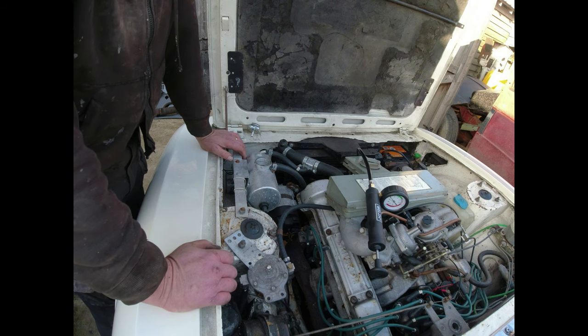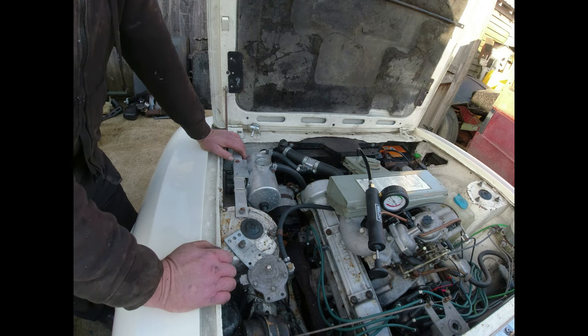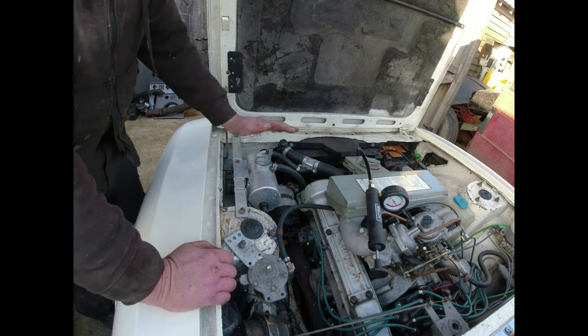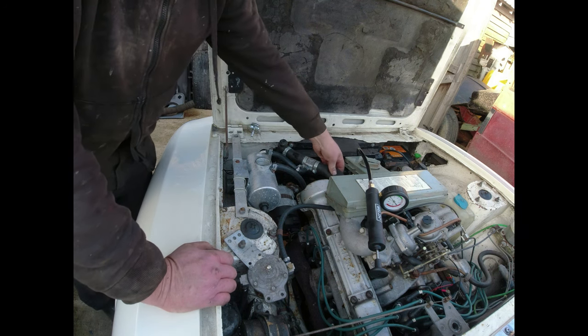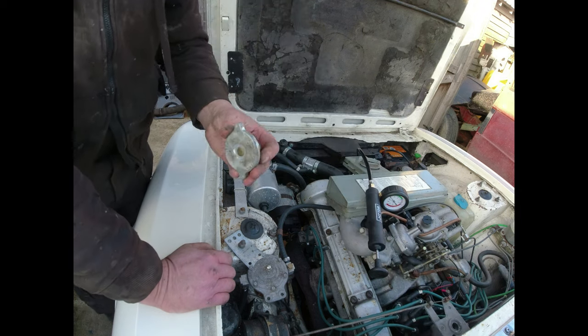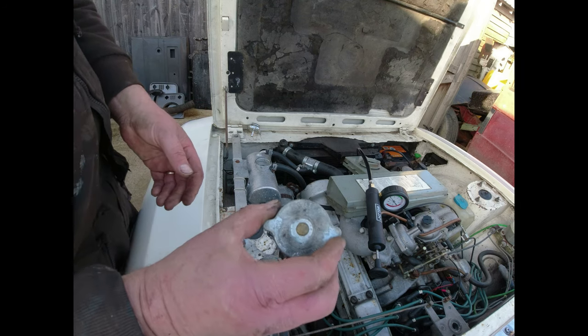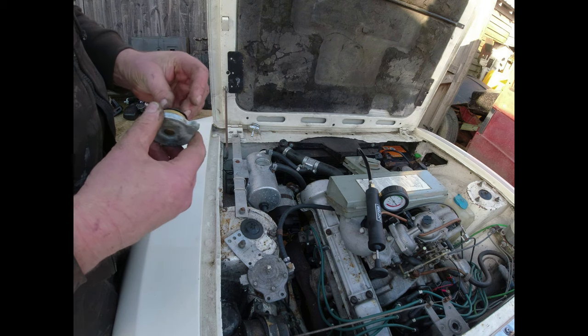I think what I'm going to do is I'll carry a big can of water with me, because the worst case scenario is that I will lose some coolant as I'm driving. But that there would explain why this never reaches its full pressure. I've had that problem with this cap before, with this tank before. I thought I fixed it. We are running a 20 psi pressure cap.